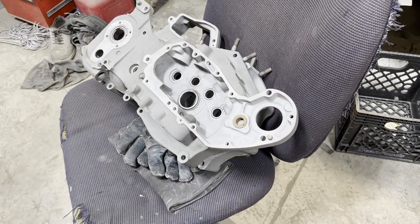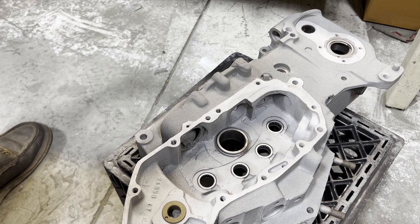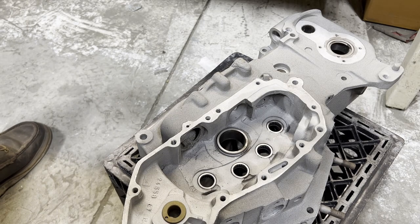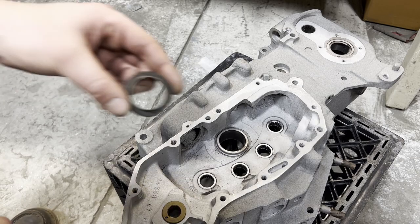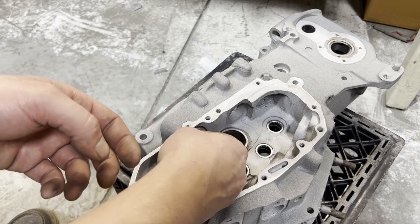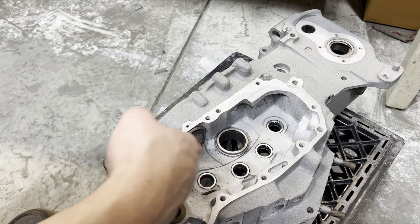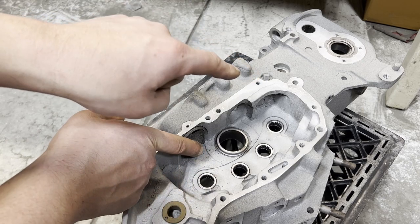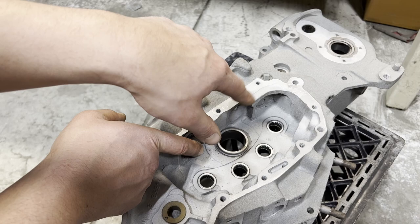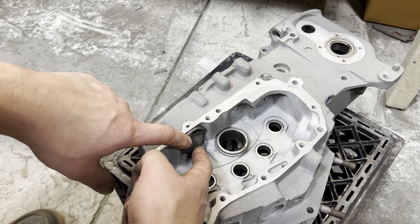Per usual in my horrible YouTube skill set — I just had the camera set up over here, talked for about three minutes while I went through and did all of this, and then realized the camera wasn't recording. So let's recap what I just did. On the iron heads you have an oil screen at the end of the pump — this sits in here like this. Here's the screen for that. I blasted these cases, so I know there's crap everywhere, and I should have done this before I put the cam bearings in because these are brand new bearings. Now I've got to re-degrease this entire case because I was an idiot and didn't pull this first.